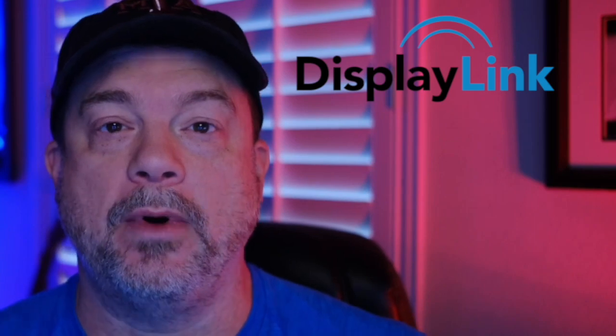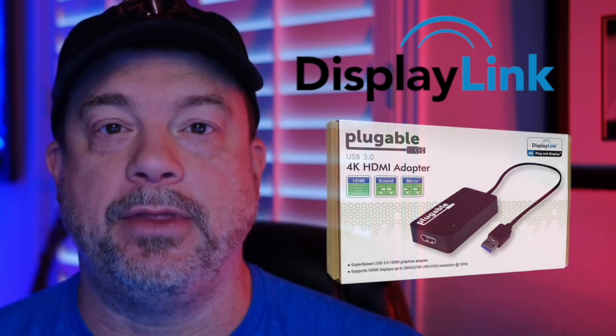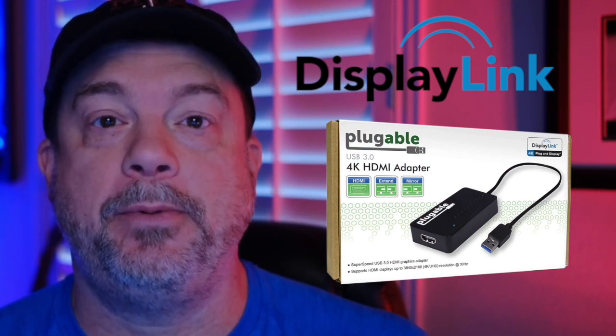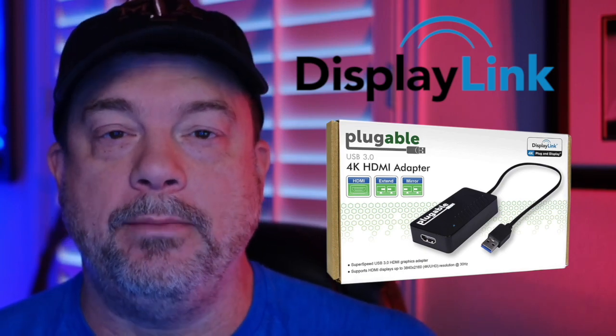There are some limitations, most of which everyone knows about. The big one is you can only drive two HDMI or DisplayPort monitors natively. The way the chip is configured, in conjunction with limitations in the operating system, you can only recognize two native monitors at one time. It's been widely publicized that you can use a tool called DisplayLink to work around this — DisplayLink is an awesome video adapter that works as a USB device, and people have reported running up to six displays on the M1 Mac Mini using DisplayLink technology.